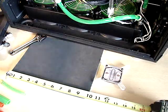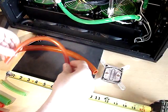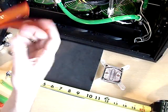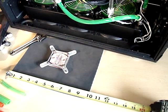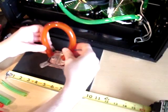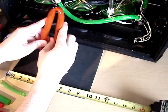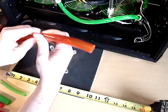What I did was cut two pieces of this red tube, one foot each, and try to bend them on a ruler to see when they start collapsing - to find out if you get any benefit of tighter turns with a smaller tube. The length of the tube for making a connection plays a difference too. With one foot of tubing, if I just try to touch the inlets and outlets of this supreme block, it's already too tight and you can see the tube starts collapsing. If it collapses completely, you have no flow going through your loop and your components will start overheating and possibly fail.